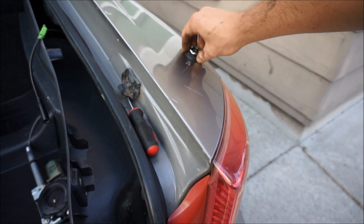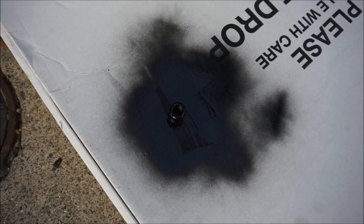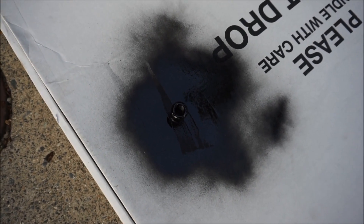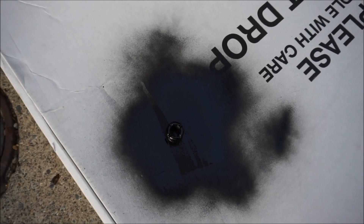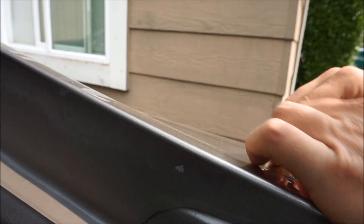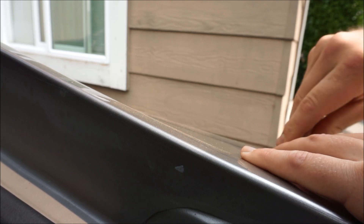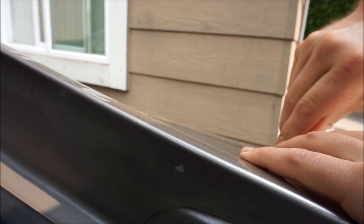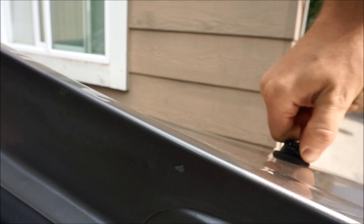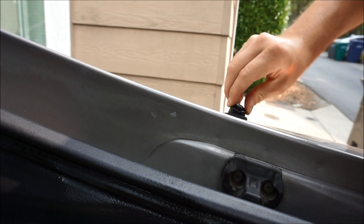So this is what it would look like with the chrome one. And then this is the OEM one from my O3 - I think I'm going to shine up and use the O3 for my O2. So there - and it's actually metal, not plastic. I scuffed it up real quick with the sanding block and then painted it gloss black. Let it sit for 30 minutes and then we'll go ahead and put it on. Here is that new gloss black - that looks good, it dried overnight. You really don't need to do the screwdriver thing again - you can just finger tighten it pretty well. I do recommend holding up that lower shaft underneath so that you can push it up a little bit and it will go pretty full tight.